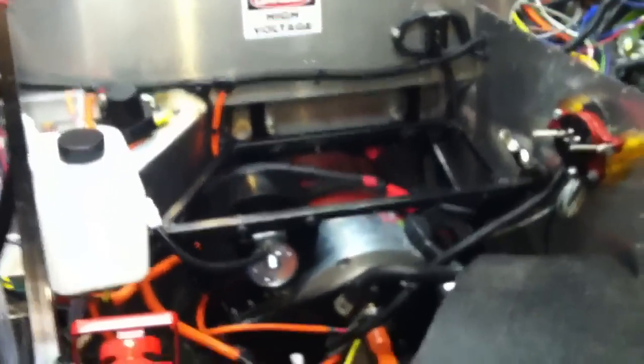There's another one of those blocks down here for the 12 volt system. I kind of like those — a nice little way to tie the pieces together. Not a whole lot of progress. It took me quite a while to get this blower motor strapped down in there. I had to make a new band to go around it, just out of some galvanized steel I had lying around. I'm going to put the electronics tray back on and power the car back up at that point. It's not that far from running again. We'll see what's next — see you next time.